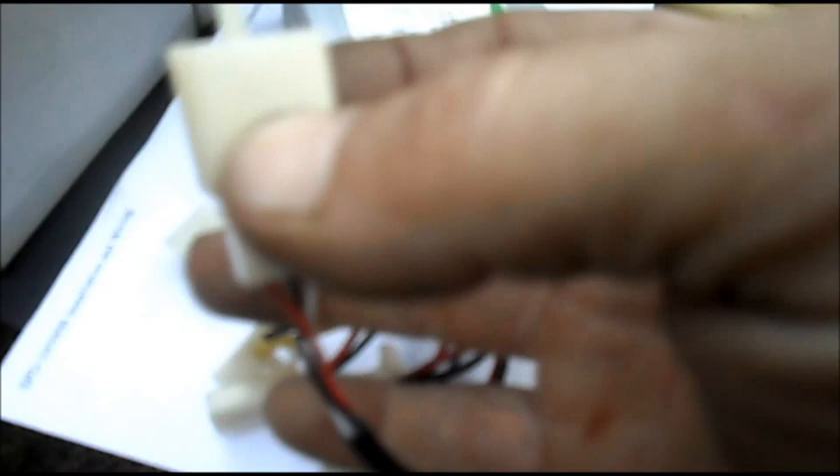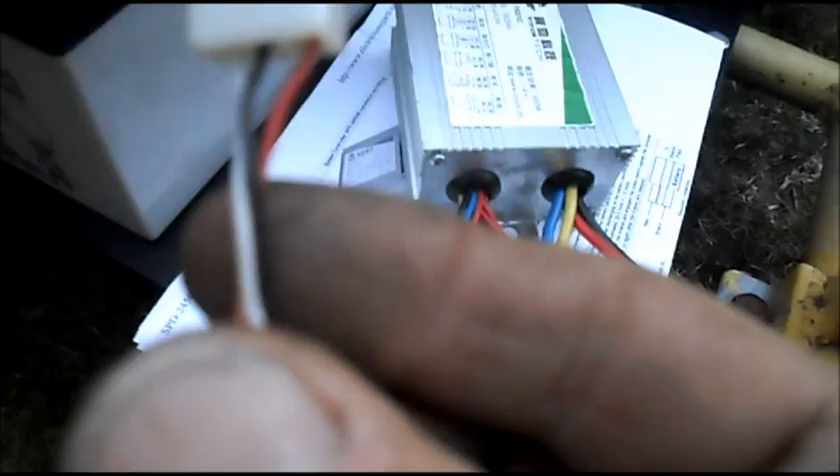It's just electronic and has a three-wire plug-in. I'll show you where it plugs in on the speed controller. Out of all our plug-ins, the two with the big wires are for the motor and the battery, and all the little wire stuff is for other things. Our speed controller is the only one that has the three-wire plug-in like our thumb throttle. You always have a red and a black — those are your power wires — and then the white is your signal wire.